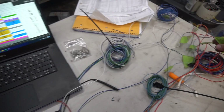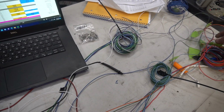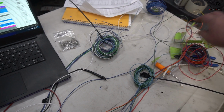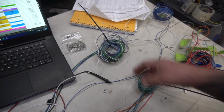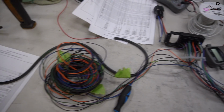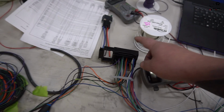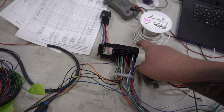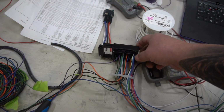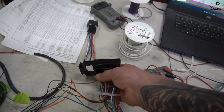We have it labeled. We know which color is for cylinder 3, and like we talked about, we follow that into the injector and the coil pack so that when we wire things, it's identical and there are no issues. So let me go ahead and show you guys how to remove the connectors out of one of these housings, these 105 pin, or even the 94 or 91 pin, depending on which ECU you have. They're all relatively the same.